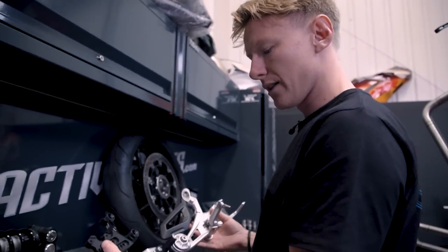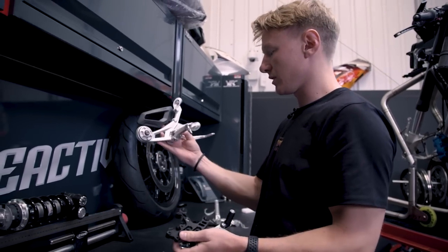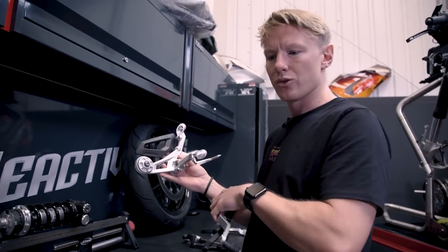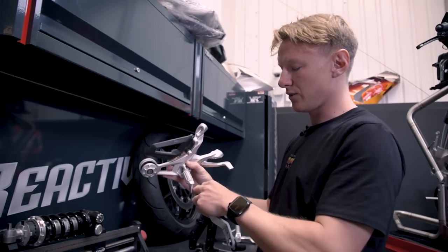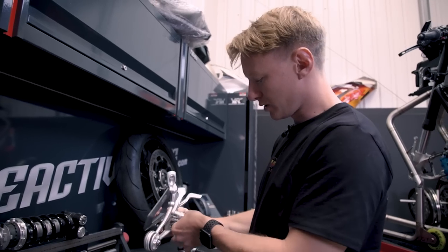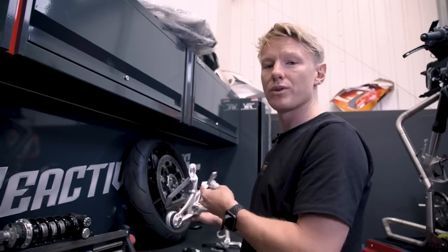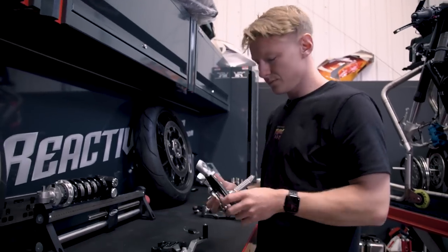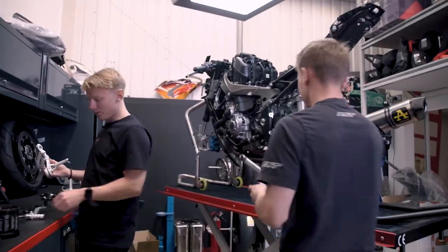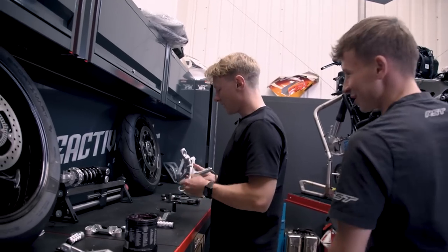You can just see the size difference — this one's a lot lighter and smaller. These have also got a lot of adjustability, so you can move your foot pegs to exactly where you want them, whereas that's fixed. These also have fold-up foot pegs, which are really annoying when you ride on track, because just when you start leaning the bike over, that will touch and pick the foot peg up. These are fixed and also shorter, so they won't scrape on the floor when you ride around. That's why you put rear sets on your bike. And they're bling.